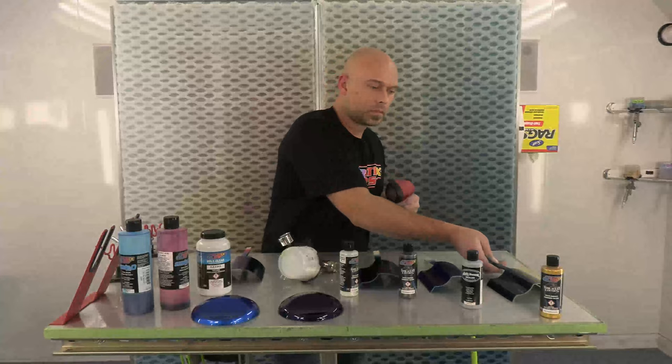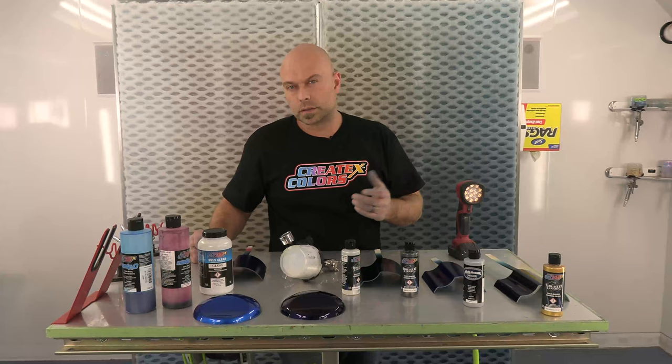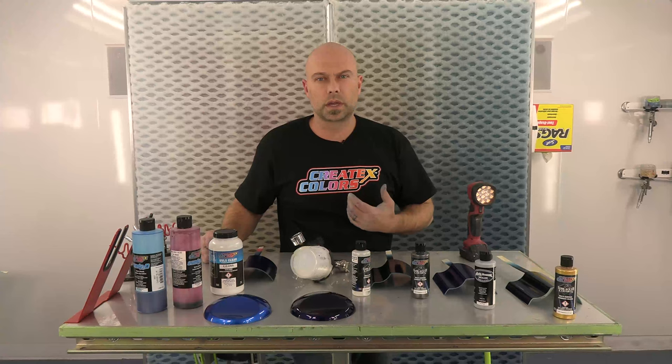Before I go ahead and clear these, I'm going to spray a 2K clear over the top. If you've seen our other videos, we do have a high gloss top coat — the 4053 — but we find that the 2K works a little bit better when you're spraying over candies. Sometimes the candy has a tendency to bleed into our 4053, so we recommend a 2K for maximum color hold-out and shine.